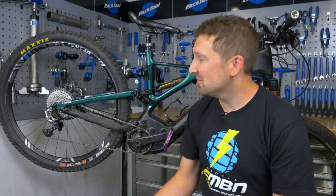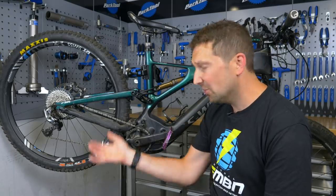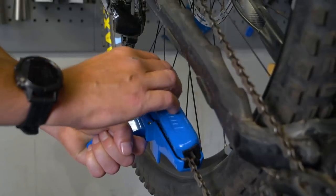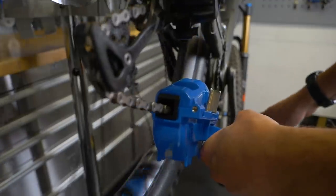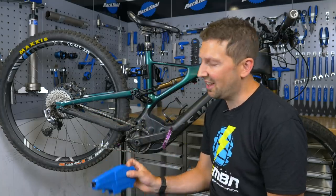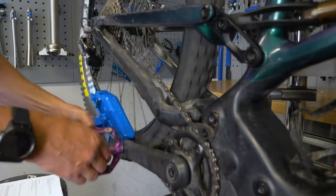The chain is one of the most important parts of the e-bike and keeping on top of the maintenance of the chain is really key to avoid premature wear on the cassette, chain ring and all the other drive items. You only need a few items to keep on top of that, and that is a chain cleaner or a chain bath. You simply fill this up with degreaser, clamp that on your chain, pedal it backwards or forwards and that way it's going to clean the chain as well as degreasing it at the same time. A really helpful tool. You can do it with a spray and a paintbrush but it's quite a dirty job, and this thing keeps all that gunk from your chain and all the horrible stuff all in one place. That's a real essential tool, the chain bath.